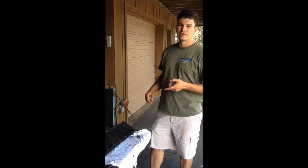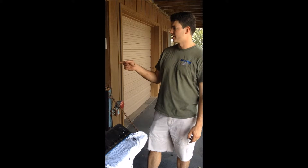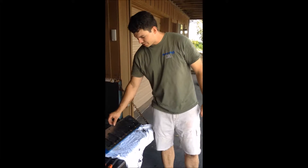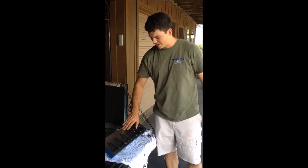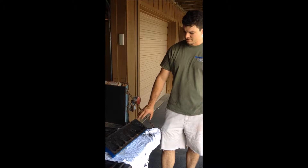I wanted to show how to modify a 3-liter Studebaker head. This is on a 1958 Studebaker pickup, the Transtar. What I did is I took it to a machine shop and I had 12 thousandths of an inch taken off the head. Today the head gets cut.